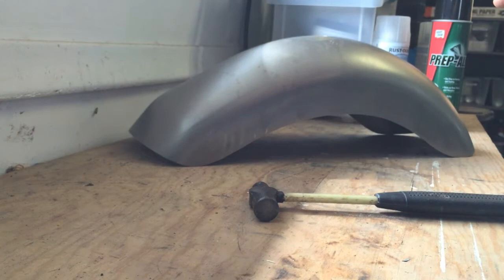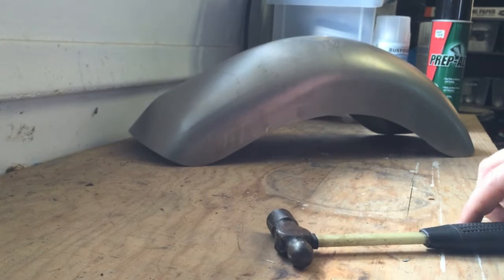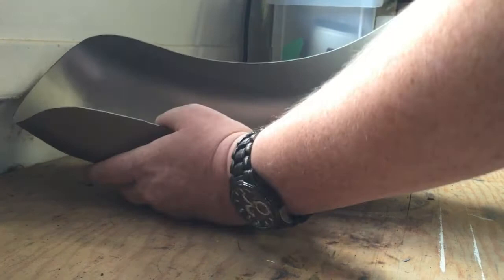This is such a small repair, I'm not ready to commit to go buy a hammer and dolly set. I specifically found the smallest hammer that I have, and it's got a rounded end on it, so that's going to help me get that dent flattened out without actually flattening out the curve of the fender. This is not a test of strength — what you want to do is very lightly tap it against the surface and start to work that out.